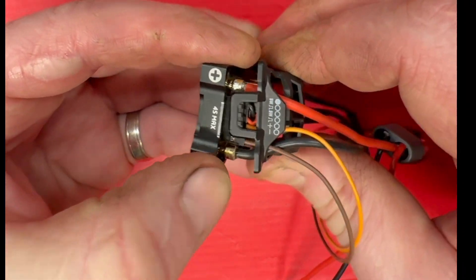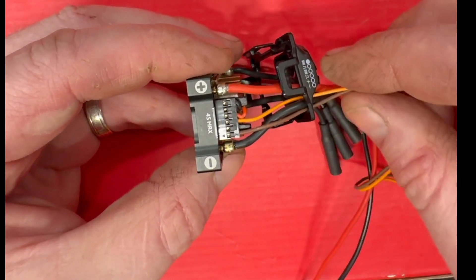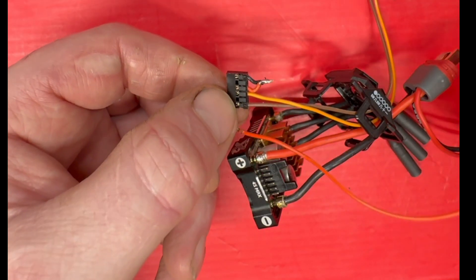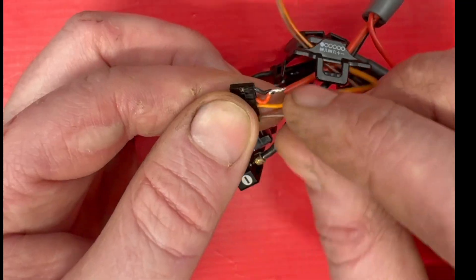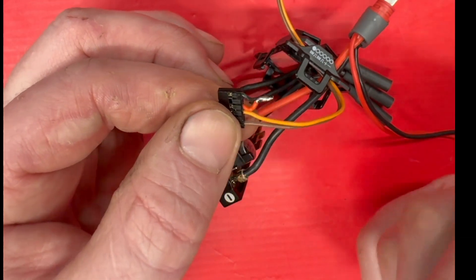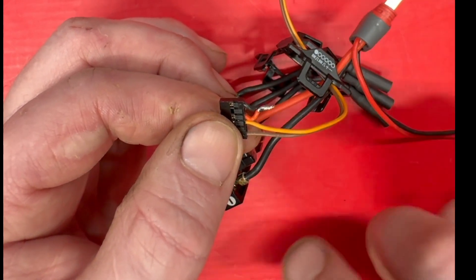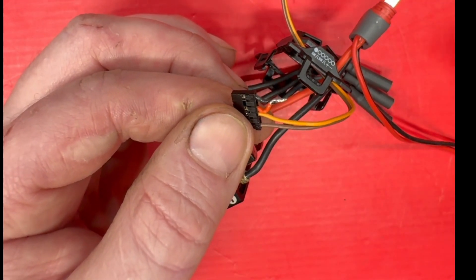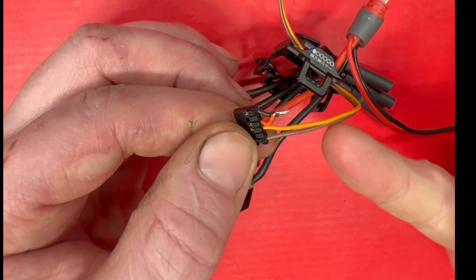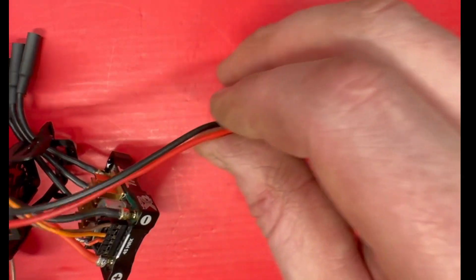Pull this off — Castle made this super easy to pull off. You've got to take that off, then just pull it off. Pull out your power wire going to your throttle. This is the power on/off switch. You'd think, why did they omit it? Well, once you shut the car off, the throttle shuts off, but guess what doesn't shut off — the steering. Everything's off but you can still steer. So there's really no on/off switch. Once you do this, arc it so it's always on, and to turn it off you unplug it.